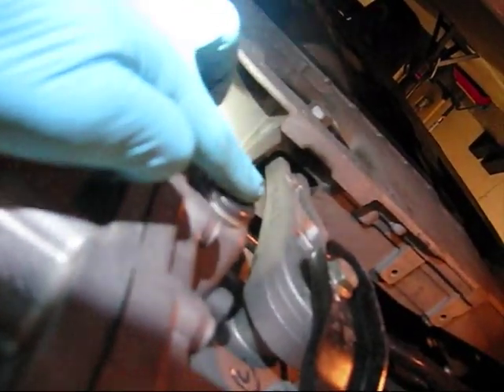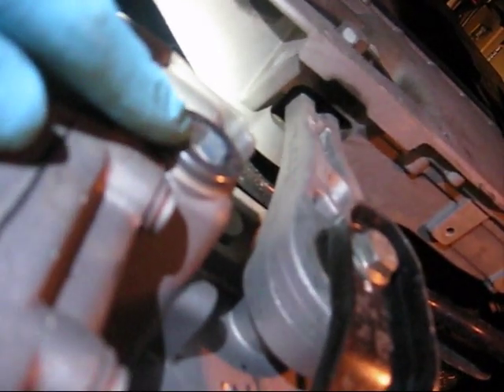Here's the inspection drain plug. It's kind of hard to look at from down below, but that's a 14 millimeter Allen head. Just break it right off and take it off — you're going to have some oil come out. After that, you'll have access to the overflow tube, which is what determines the oil level. It's like a standpipe — any excess oil will overflow into it and drain right out.